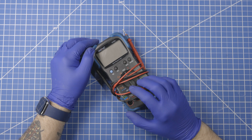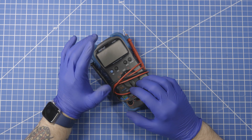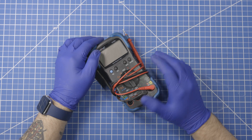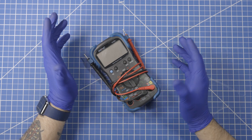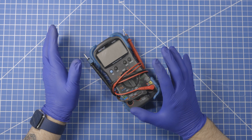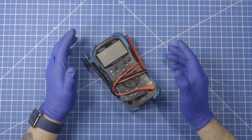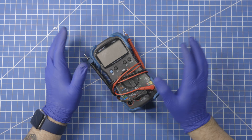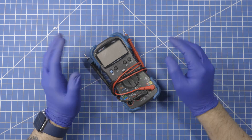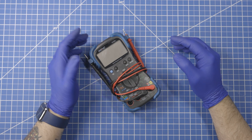So checking the voltage of your battery and then checking the voltage of the alternator, which can tell you if the alternator is charging the battery and or if the battery has some basic voltage issues. Now that doesn't tell you everything — you would need to apply load to confirm that a battery is healthy. I'll show that in a future video so I'll link that below once that video exists. If you're watching this video early after its release, that link won't be down there because I haven't recorded it yet.